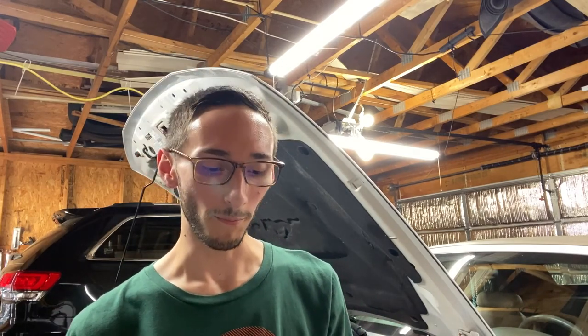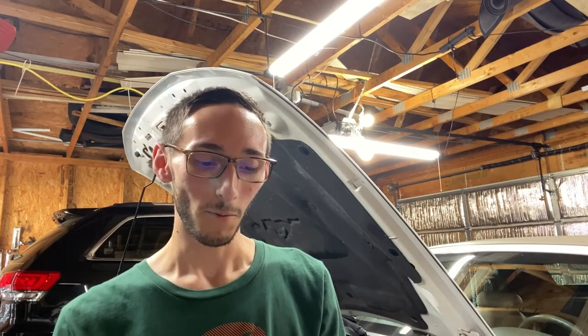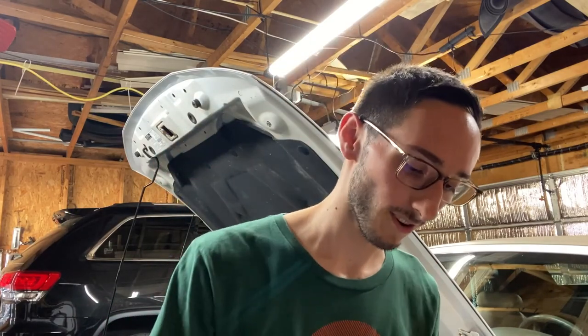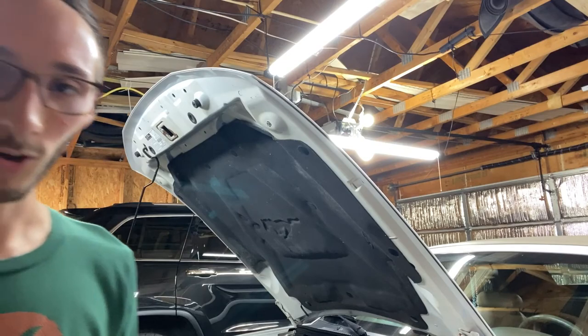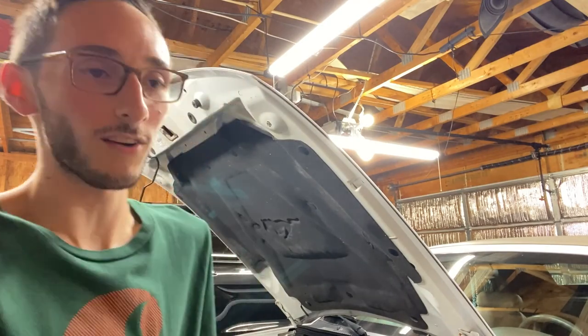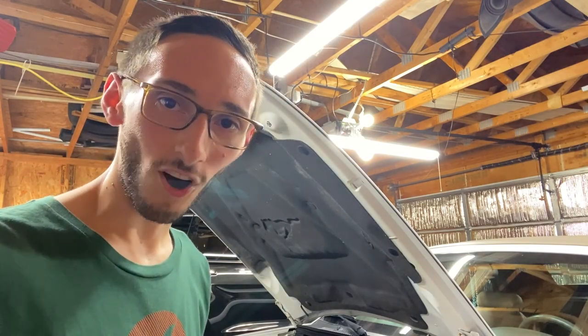Okay, so get this. There's no need to prime your oil pump before startup, unless you have a new oil pump, I'd imagine, right? But you can either disconnect the crank sensor, or you can hold the gas pedal all the way down when you're starting the car, or you can take out the fuel pump relay, whatever. You could do it a few different ways, but Todd Warren actually taught me this way.